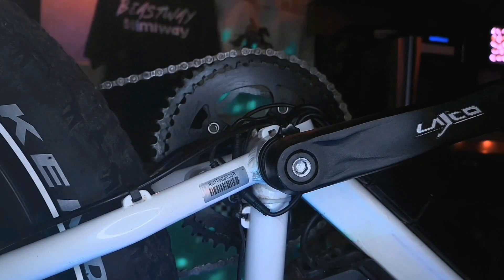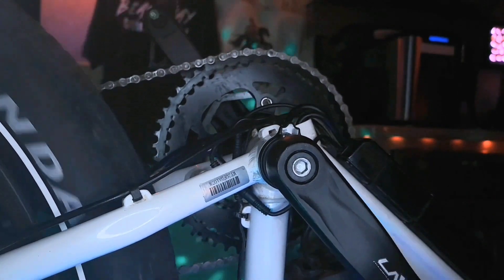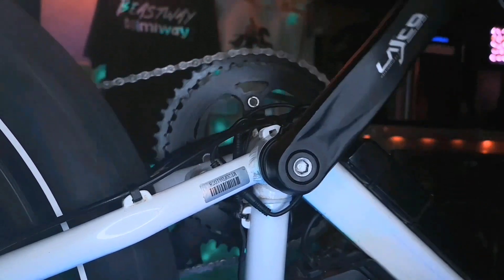That's it, and we're all set and ready to test the sensor. First, we need to power up the bike and check the sensor's LED indicator. The light is red. We can test the sensor by placing the bike in level one and carefully rotating the pedals forward to engage the sensor.